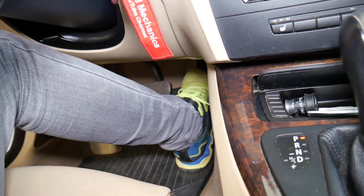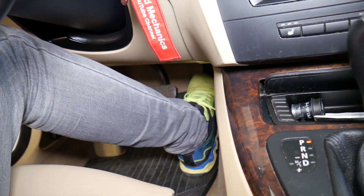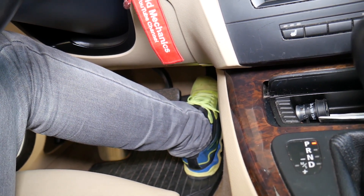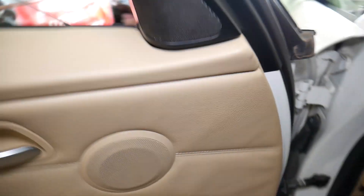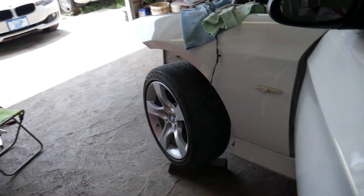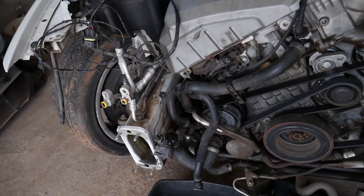Next, do not start the car — press the gas pedal for 10 seconds. You will hear your pump start running at about 10 seconds. We're just waiting now — it's been about 4 seconds. I definitely heard ours start. Remember: do not close the door, as it can stop the procedure.